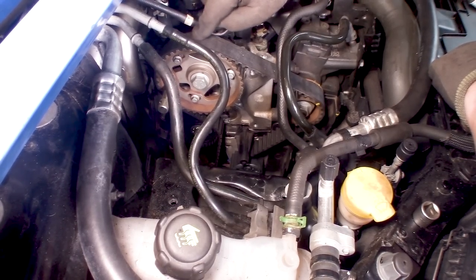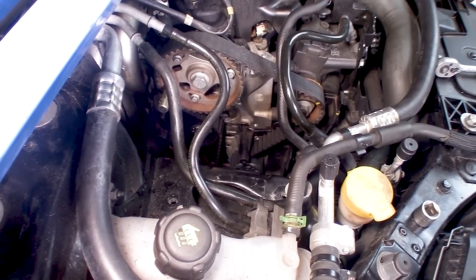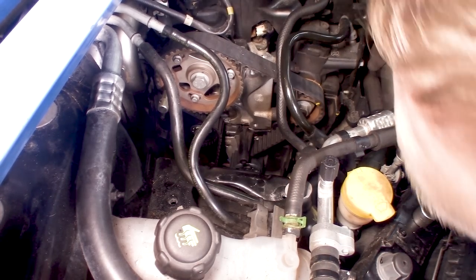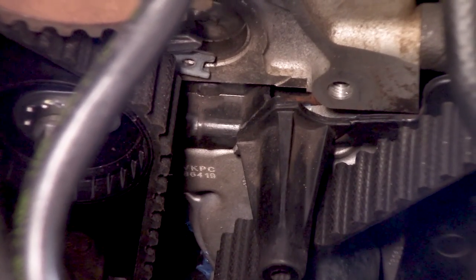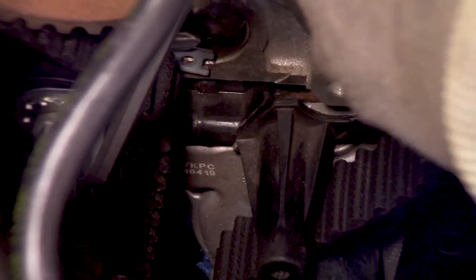As we can check, this one is over here, this one is on the mark here, and I will have a quick look at the bottom. And the bottom is also in its place. The only thing that is now off, and as expected, the tension of the pulley is off, as you can see, but that is what I expected. So no worries there, just tighten it up. And just to be sure, we are doing a couple more revolutions.